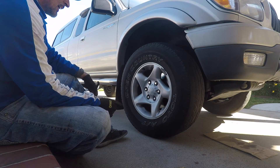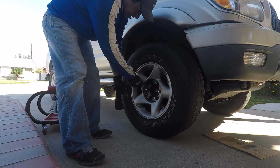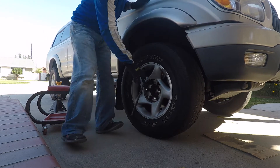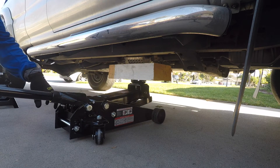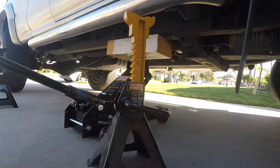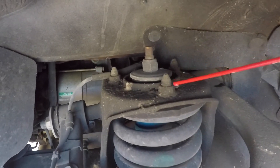Using the bevel end of the wheel nut wrench, pry off the wheel center cap. Make sure you loosen the wheel nuts before raising the vehicle. Make sure the jack is positioned on a level and solid place under the frame side rail, and also use a jack stand to secure the truck. Remember, safety is first. Add WD-40 to the top three nuts that hold the coil assembly.